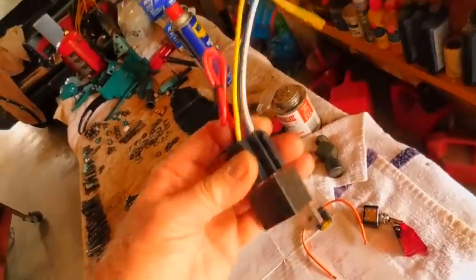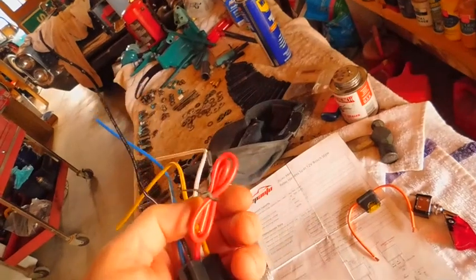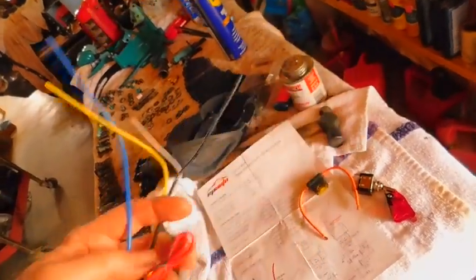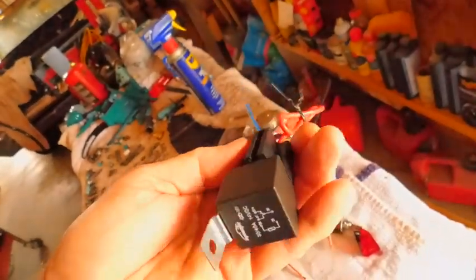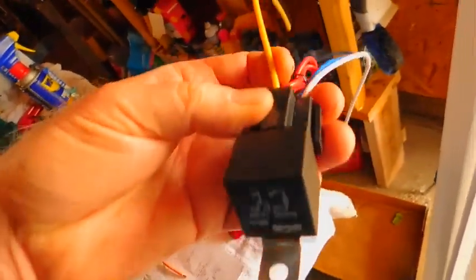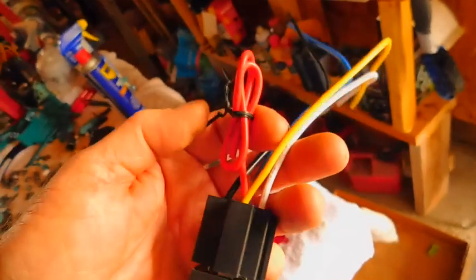And then you got to put your relay on. I've learned something interesting about relays, depends on where you get them. The color coding can be a little different. The blue can be the red, and the red can be the blue, or there might not even be an 87A, because you got the 4-prong relay. This is a 5-prong, which means that the 87A is on when it's not energized. So when it is energized, you go to 87, and 87 is the yellow one, and that's the one that comes on when the relay's energized. But they can be different, and I actually have a couple of diagrams of some I've had in the past, and the wiring color code's generally different.